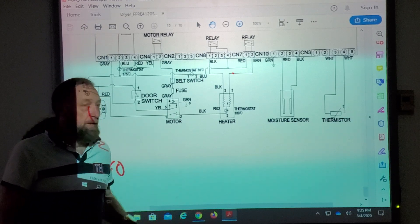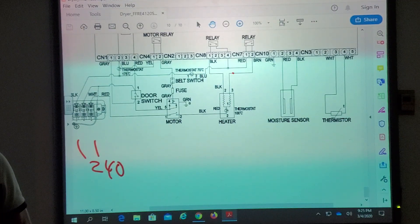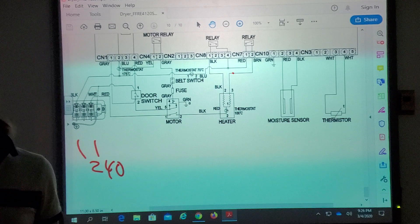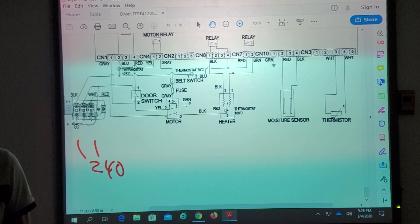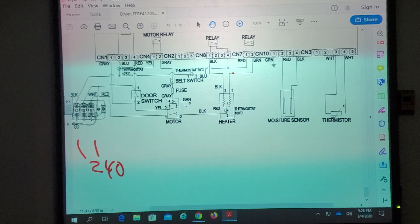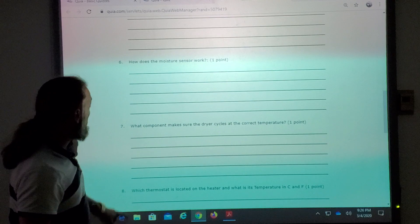The complaint in that case would be shutting off before clothes are completely dry. If the customer complains clothes are still wet at the end of the cycle, it's usually a ventilation problem or the dryer isn't heating enough. But if everything tests out and the vent is connected and you're getting 145°F out the back — it should dry in 35–40 minutes — and it's shutting off sooner with wet clothes, the sensing bands may not be working. We had a case here where we cleaned a Whirlpool sensor and got it working.